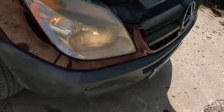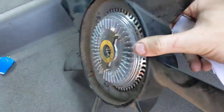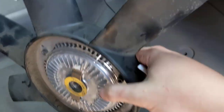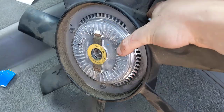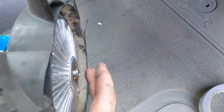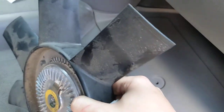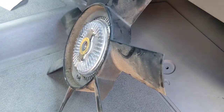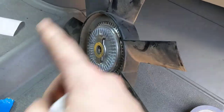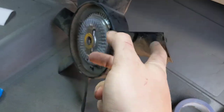So a fan clutch can fail in two ways. This is your fan clutch — the middle part is your clutch, and this is your fan blade. It's a viscous fan clutch, meaning inside of this clutch is full of fluid. When that fluid gets to a specific temperature — basically when the motor heats this up — that fluid expands and engages the clutch, which puts force behind these blades. They designed this so you can have a spinning blade without any force while getting the motor up to temperature, and then once the motor reaches a specific temperature, the fan clutch kicks in and forces air over the radiator and cools your coolant down.